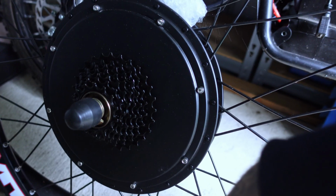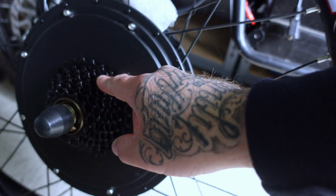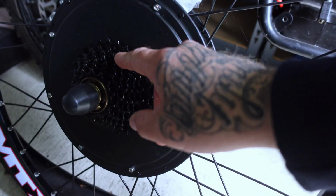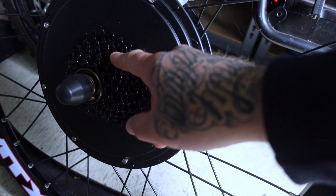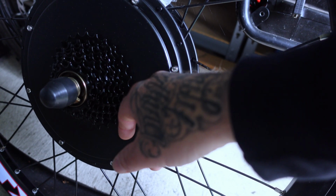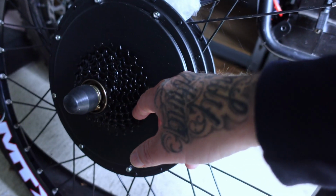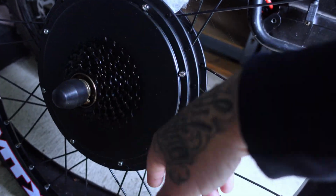The bike I'm looking at today is an 8-speed, so I'm looking at swapping the cassettes hopefully straight over without too much hassle, depending on whether it's a cassette or a freewheel. If one's a cassette and one's a freewheel, then I'm going to have to purchase a sprocket or cassette or whatever you call it. So that's something else to bear in mind.